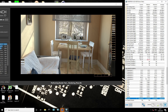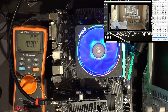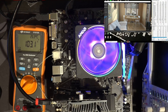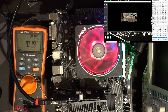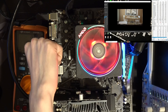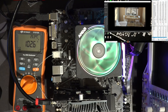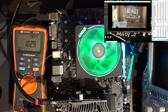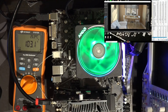The thing is, the cooler is blowing air straight down onto the board. You don't replace this with fancy case airflow. The only way you'd replace something like this is if you bought a 2500 RPM fan and attached it directly over the motherboard if you're using an AIO, which I don't think many people would be doing. At the same time, many people wouldn't be putting a 3950X into an A520MH motherboard, because this is literally the cheapest A520 motherboard Gigabyte makes - one of the cheapest AM4 motherboards Gigabyte makes in general.